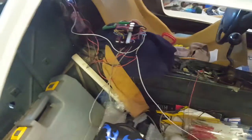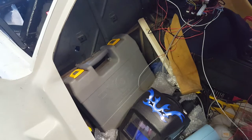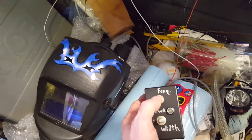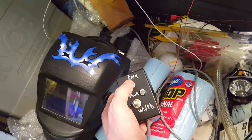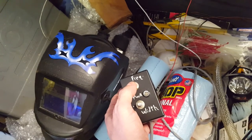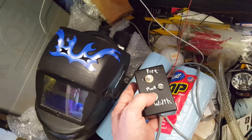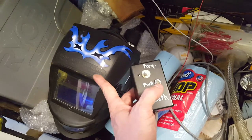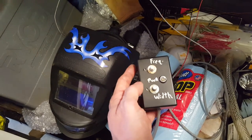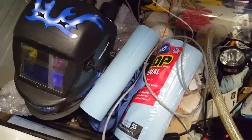The other Teensy has his fuel pulse width spray coming from the original computer, and then this guy is multiplying how many times per second the other one says to spray versus what I'm saying to spray — and I'm cranking that way up, making it spray way more often. Then there's the width, and I've got that turned up pretty high. The middle should have been wherever the midpoint of the spray from the fuel computer is, so I may be a little higher than that by now. I haven't reset it back to zero to find out.